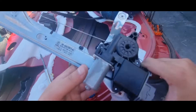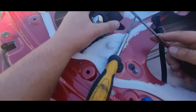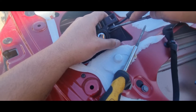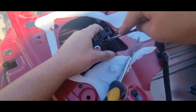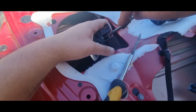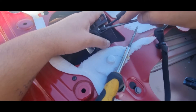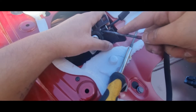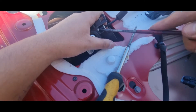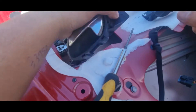As you can see the window regulator is off the door. Next we'll remove the door handle. Be gentle with this part as these clips easily break. Gently push that clip and then pull the cable for the door handle off. I'd be very cautious here because these clips really do break very easily — they almost look for a reason to break without you doing anything. That's why I'll be taking my time doing this one.